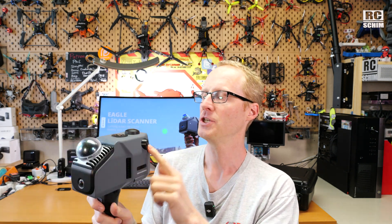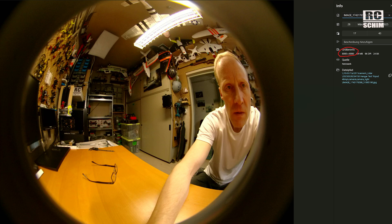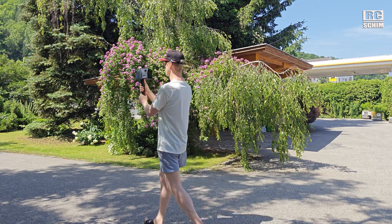Another thing that wasn't working initially is 48 megapixels. They advertise four 48-megapixel cameras, but during a moving LiDAR scan you only get 12-megapixel stills. If you are in tripod mode while LiDAR scanning and press the button, it will take a 48-megapixel image — only then. In handheld mode you should walk smoothly, because even walking smoothly outside I got a lot of pictures quite unsharp.